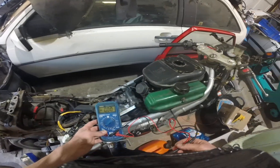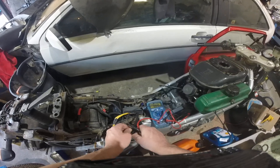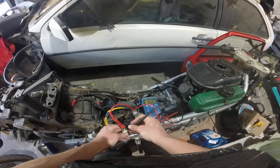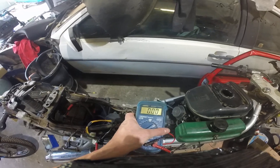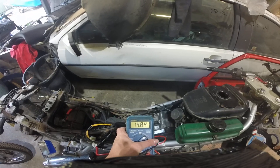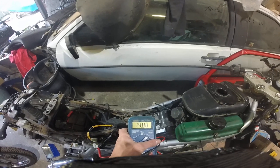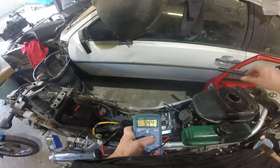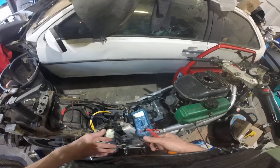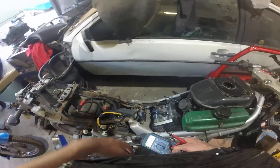So for this we're going to use the multimeter again, on DC voltage this time, so I shouldn't be seeing any higher than 14. 20 volts is a safe range to check it on. I'm going to put my terminals straight in there and then fire the bike up. It was rectifying perfectly — showing a little high, but there's no load on it. The rest of the electrical circuit will bring down what it's putting out.